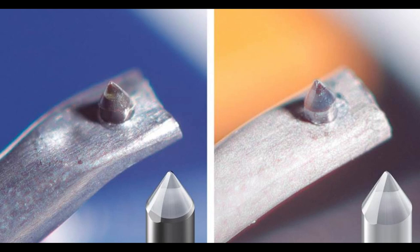Here's a graphic comparing bonded and nude styli. A bonded elliptical has a diamond chip on a metal shank cemented to the cantilever. A nude elliptical is a bigger, more expensive piece of diamond — more complicated to cut since you must cut both the tip and where it connects to the cantilever. The advantage is it's very light, gives a direct connection, and you usually get much better high frequency response. When you move to a nude stylus, a lot of distortion goes away. It's the next step up beyond any bonded stylus being manufactured today, and I like to stick exclusively with nude styli.